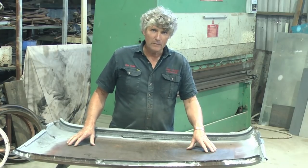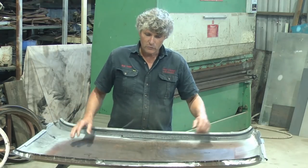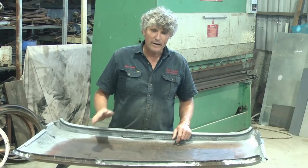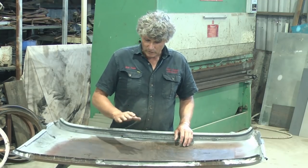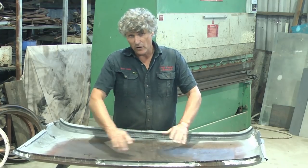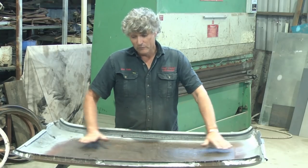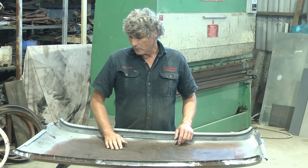Today there's a lot better material out there on the market and some of them are a spray-onable sort of proof coat, but you can get them now with little ceramic spheres in them, which will cut down the heat a fair bit. The actual fact that you've got anything up there will stop some of the drumming that'll come through the roof. And even the adhesive dynamat type stuff where you've got an adhesive layer of a black sticky with a silver paper over the top of it, that'll work really well in these applications too.